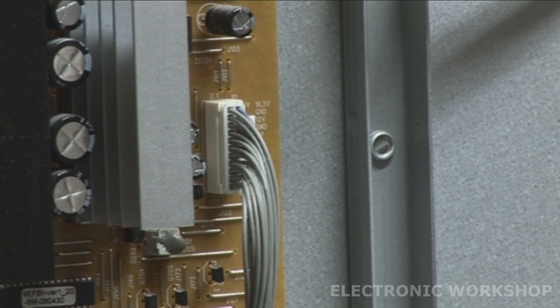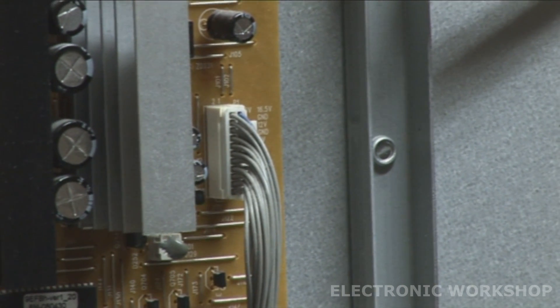The relay-on VS and relay-on readings are at 5 volts. M5V is at three volts, and the next bottom one is also at three volts. I'm not too sure what they should be at, but the rest of the voltages are roughly about right. So I can say more than likely the power supply is having no problems, though you can never be a hundred percent sure.